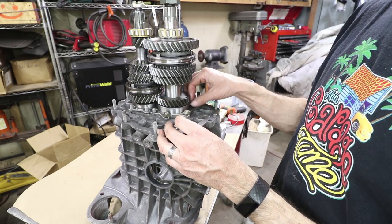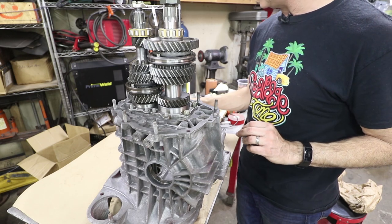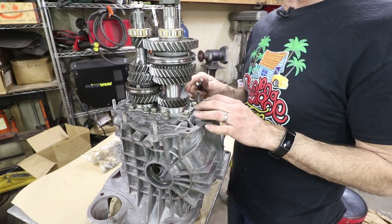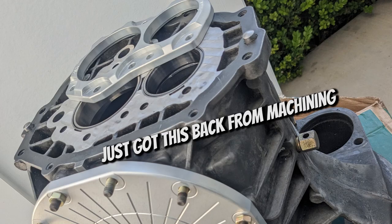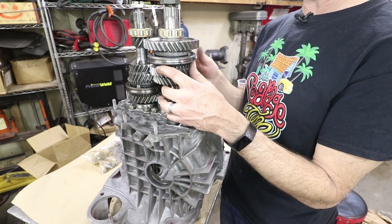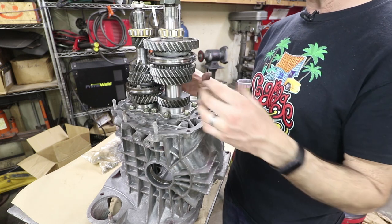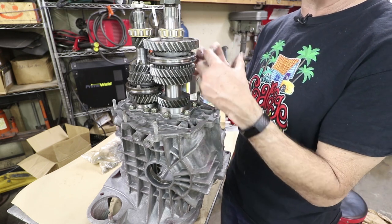It is smart to put both in and torque everything — including these nuts up here — because it changes the forces in the housing and that can affect the pinion depth. I'm going to follow the workshop manual to a T. Another common upgrade on these transaxles is a one-piece bearing retainer in 7075 aluminum. It does a better job of keeping these two shafts together because as torque is transferred from one shaft to the other, these shafts are always trying to pull each other apart. A one-piece bearing retainer strengthens the housing and keeps the shafts together. There are significant forces always trying to rip these gearboxes apart.